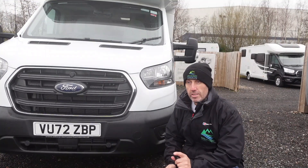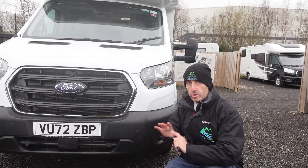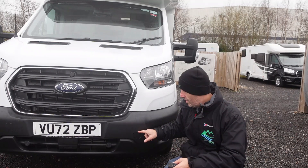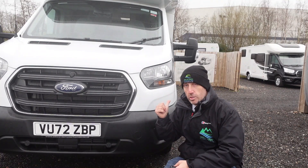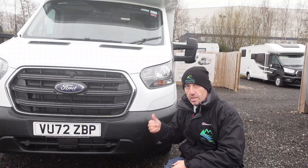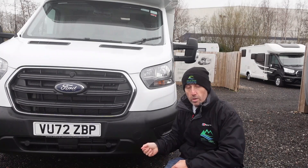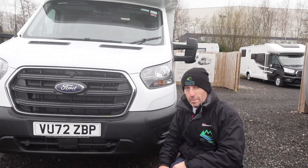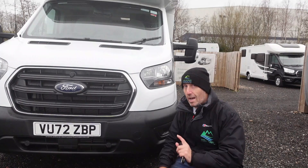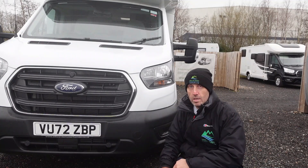Should you need to get towed off — if you get stuck in a wet pit or something — this is the front tow point. There's nothing on the back of these, so you cannot be towed backwards, only forwards. Pop a key or little screwdriver in there to remove the cover. There's a screw-in tow pin in the locker on the back, and a little tow rope under the seat inside. Be aware: any damage caused by getting towed off will be billed to the customer. If you need towing backwards, it'll have to be a recovery company going underneath to the chassis.